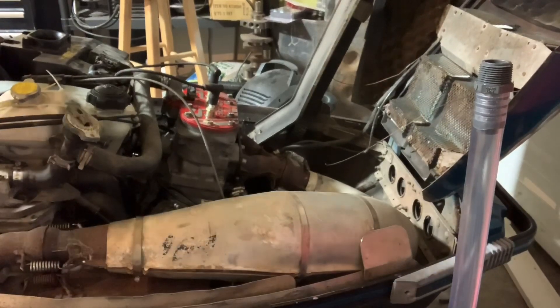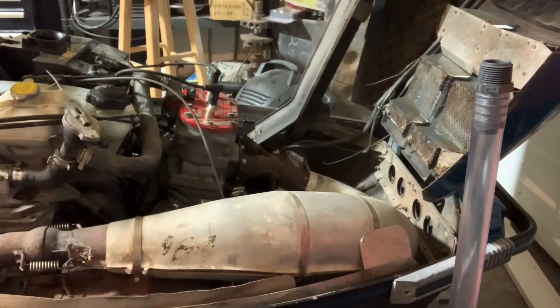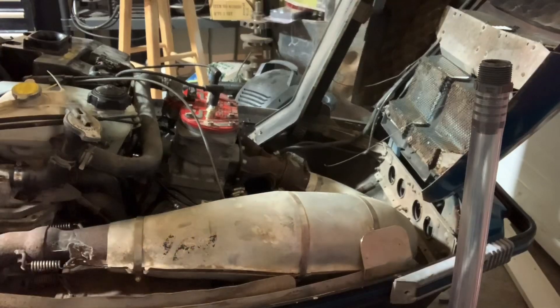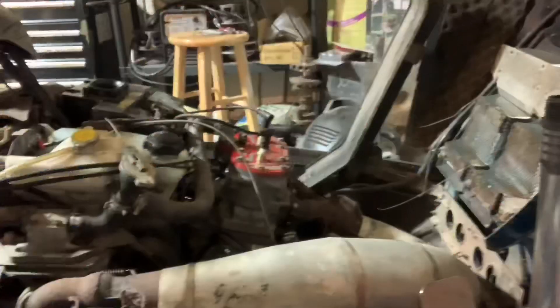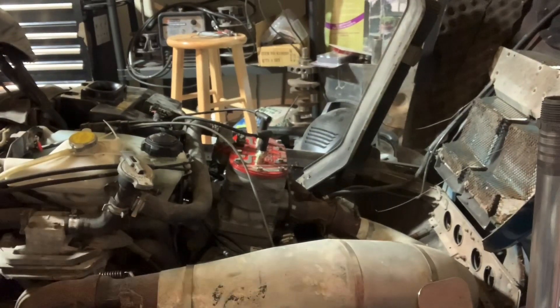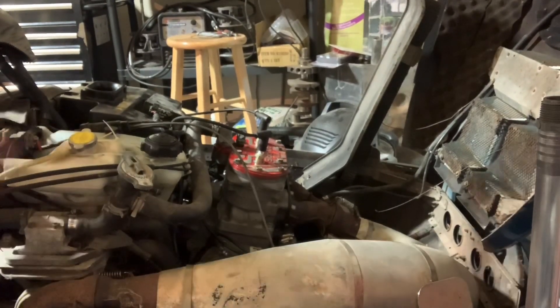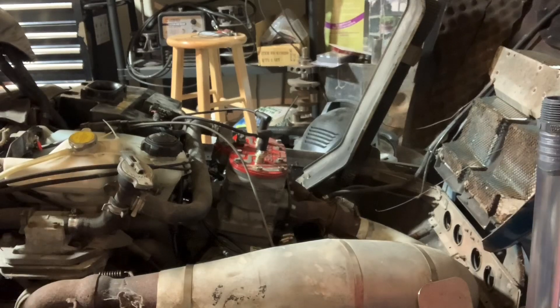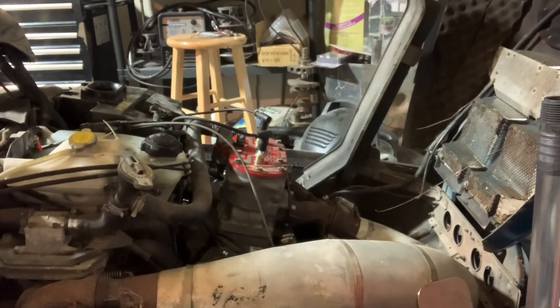This thing is not picking up the fuel. Then I thought of something — I don't think I ever hooked up the pulse line. I'm like 100% sure I did not hook up the pulse line, and that's why it's not picking up fuel. Pulse line is now connected — it was disconnected. Ran it with the drill for a bit, got the choke pulled with those vice-clamp pliers, and we're going to see if it'll start now.